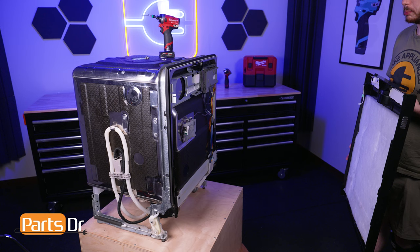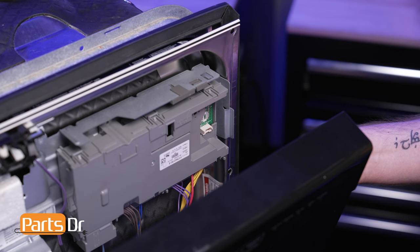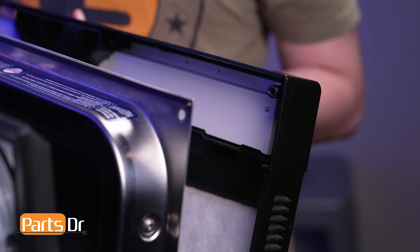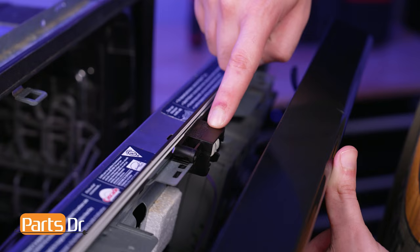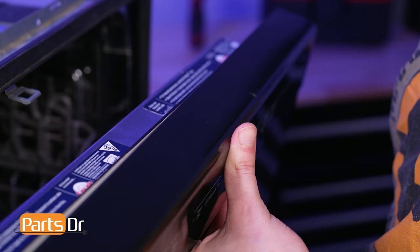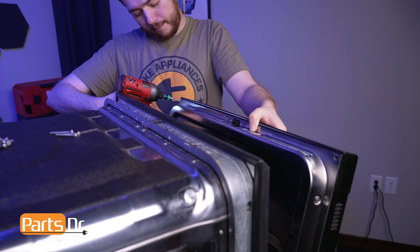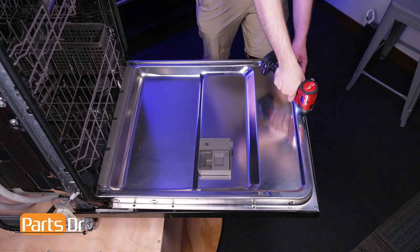Now align the hangers on the panel to the arm hinges on the door and gently slide the panel into place. Then reconnect the electrical connector. Now align the screw holes on the panel to the screw holes on the door, being sure that the locking mechanism seats beneath the panel. Start by installing the two top corner screws, bearing in mind that the four larger screws belong on the top row. Then, while supporting the panel, reinstall the remaining screws.